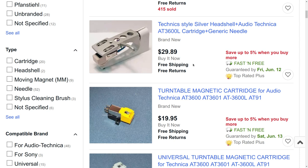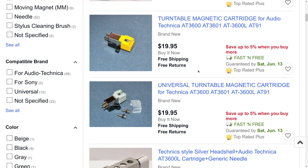The hex bolts can be a bit of a pain if you don't have a miniature hex set. What I did was grab a couple of little flathead screws and swap them out, since I had them on hand. You can also just use a flat-head screwdriver of the right size and wedge it in tight enough, or use a little jeweler's screwdriver set. You can also buy these in bulk if you're somebody who refurbishes turntables — this would be an excellent choice to ship out with refurbs. It won't cost you much, it sounds very good, and getting replacement styli is a breeze since this is probably the most common cartridge in the world.